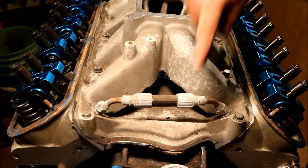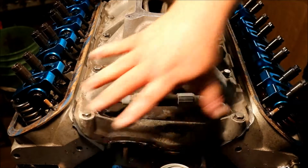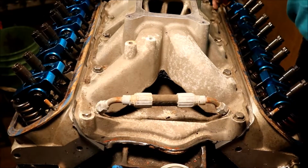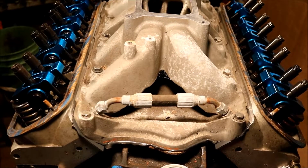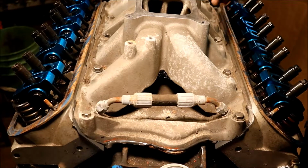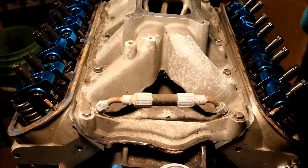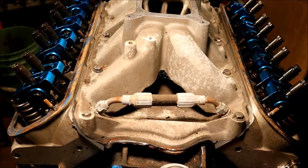The ends are RTV'd to the gaskets, which are stickied to the block. The ends around the water jackets are RTV'd to the water jacket openings. And the center bolts are just pressing the gasket backing against the head, and then the blue rings around each port are sealing that.